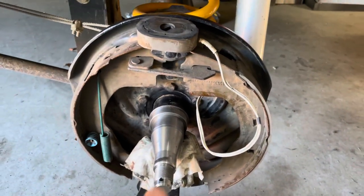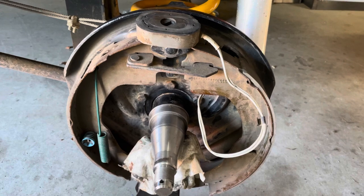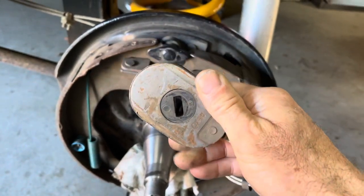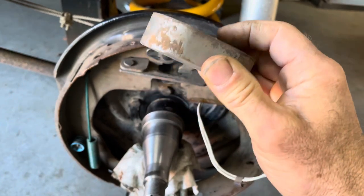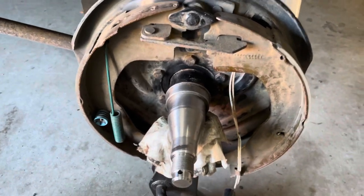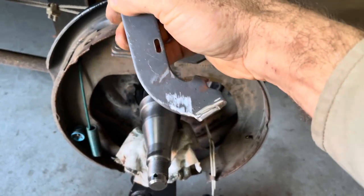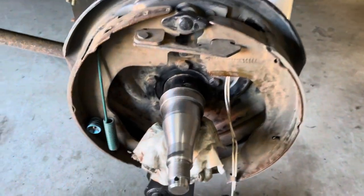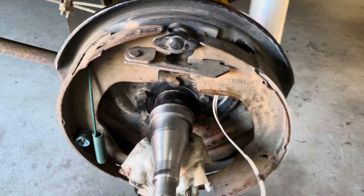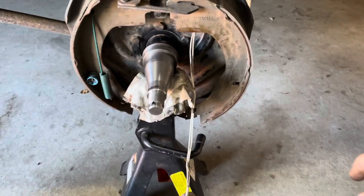This is an off-road variant. To explain what that means: there is absolutely no difference between an off-road and an on-road drum brake besides the magnet. The off-road magnet has a plastic insert which stops it from wearing the lever it sits on. An on-road magnet has a steel insert which will flog out the magnet and lever, eventually jamming and locking up your brake drums. So make sure your van has off-road magnets installed.